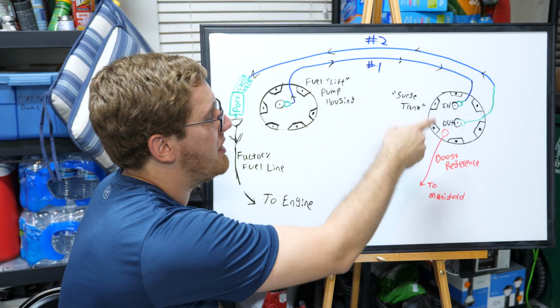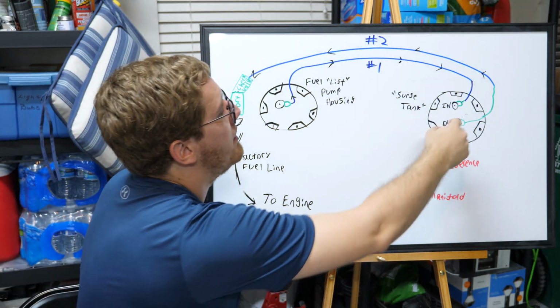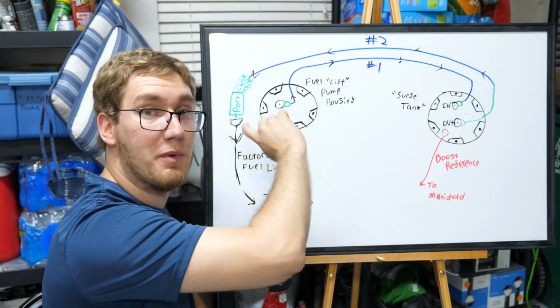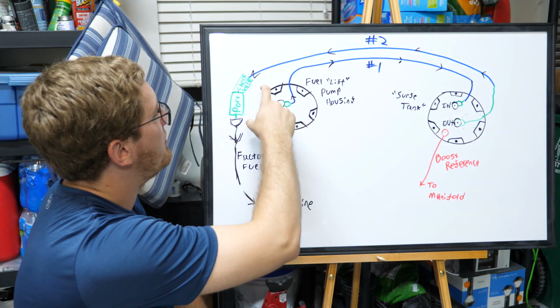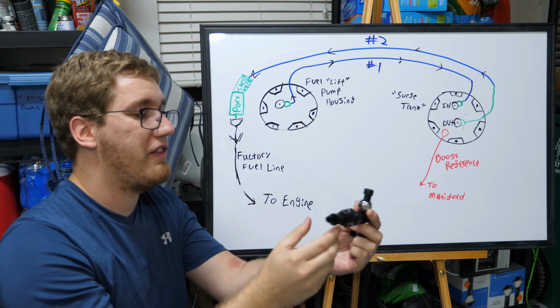The two fuel pumps in here are going to be able to send fuel out through the output side, again through one of these adapters. This is going to go through our number 2 hose. This is why it was pretty important to label them, is because we want to make sure we don't mix up the ends of the hoses on either side. It'll come back through the number 2 hose, where it's going to intercept this thing here, which is essentially just a check valve and the port.